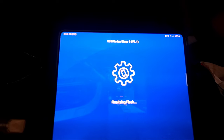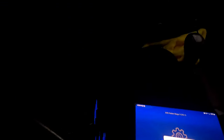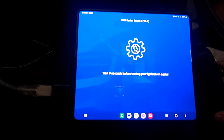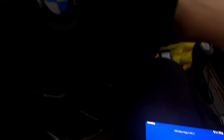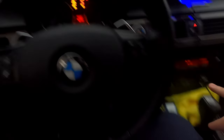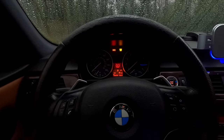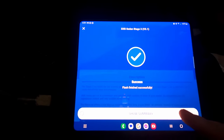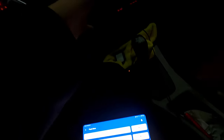He's doing his thing. Finishing up — I heard two clicks from the transmission total. Turn your ignition off to continue. Turn it off completely, continue. Turn your ignition on again — don't push the brake. Clearing fault codes, exactly the same as MHD, very similar. Boom — success! We finished. Took about nine minutes and I think we're good to go.